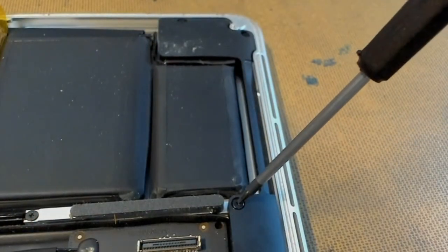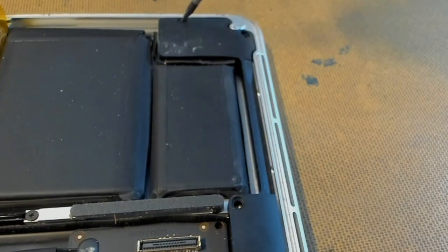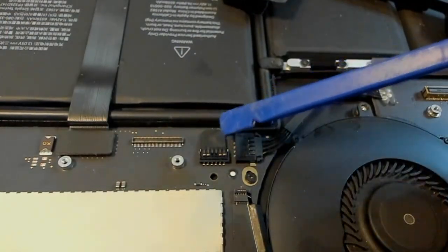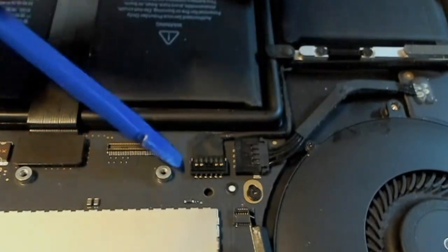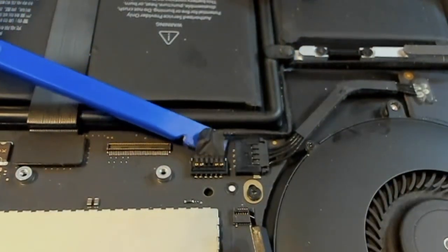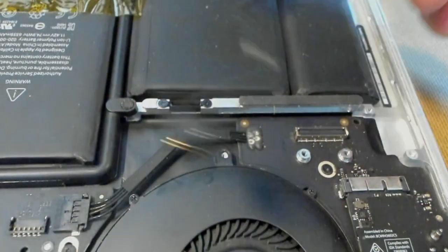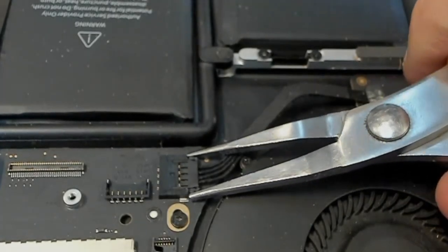We move up to our next speaker — T5 screws. Lift your speaker assembly up, then unplug your speaker from this location here. Slightly pry your cable up with your little spudger — there'll be a little bit of adhesive — give it a quick twist and it should pop up. Then remove that whole speaker assembly, gently prying up the cable as you go. We remove this other connector to the daughterboard by squeezing the tabs either side and giving it a bit of a wiggle backwards.